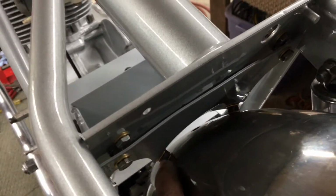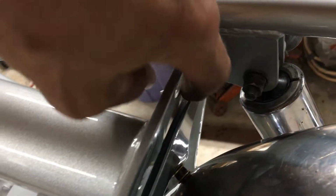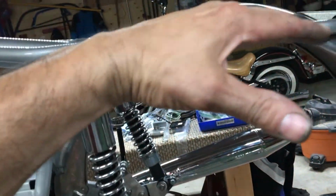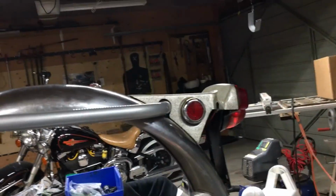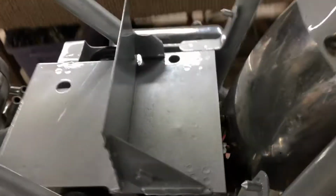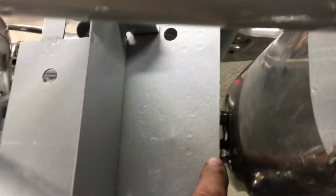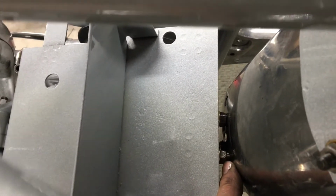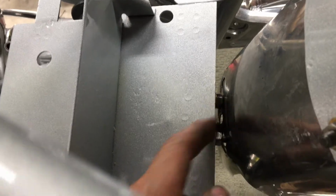And what I had to do was put 2 more spacers in there, like a nut there, nut there, just like there is on this plate. I'm sure that plate comes with that nut in there from the factory, because that's the way I took it apart. But just by putting that extra nut in there, I'm able to tilt the fender down a little bit and bring that up. And I still have that issue down there. Can you see? You got a big gap here on that nut, and this nut's tight.